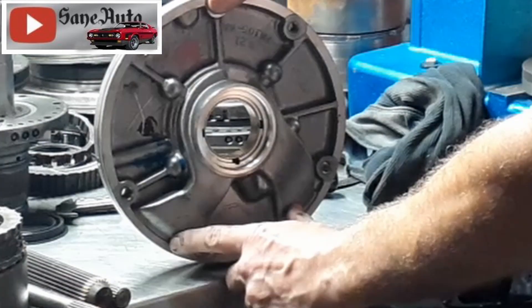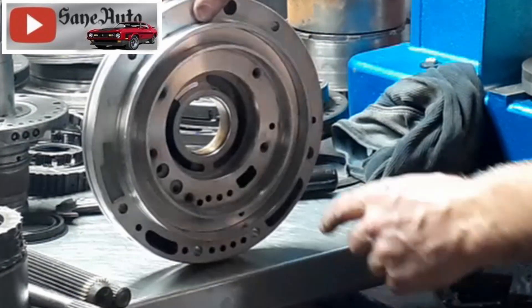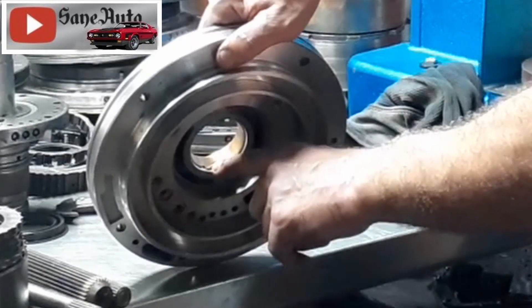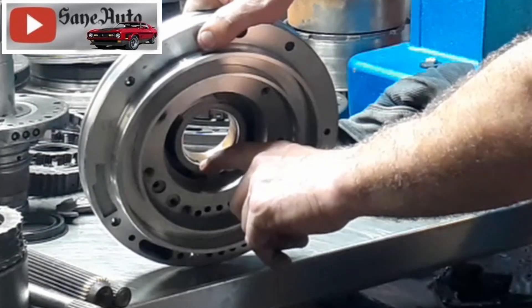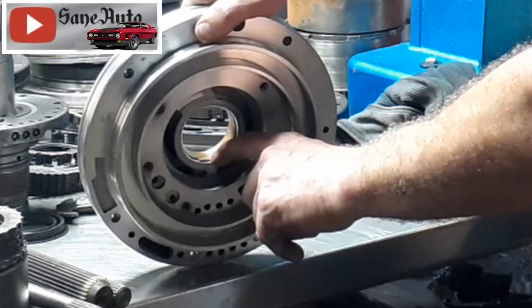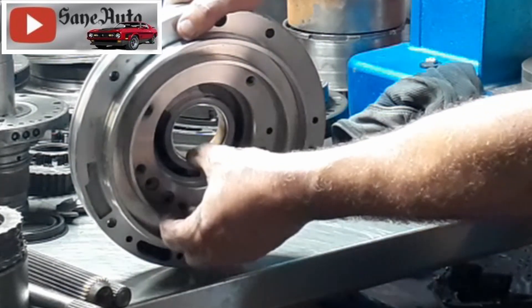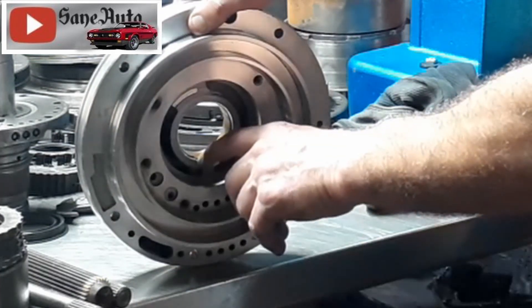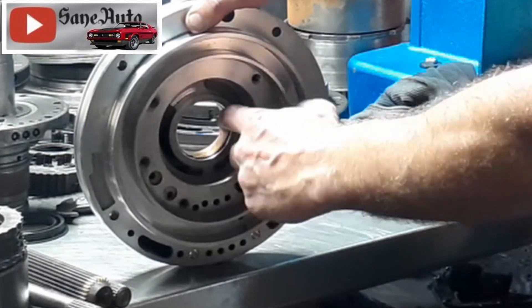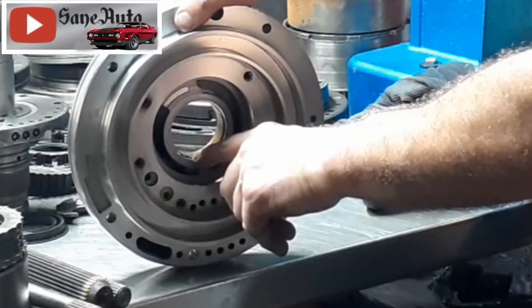You've got an inlet and exhaust down here at the bottom — this is the bottom part of the pump — and your top bolt hole is going to be up here. This is significant because when you put the new bushing back in, you want to line up this groove right here. That groove is important because it needs to be at the bottom to allow fluid to get into that groove when you first start up the engine, spreading all around the bushing and lubricating it very well.